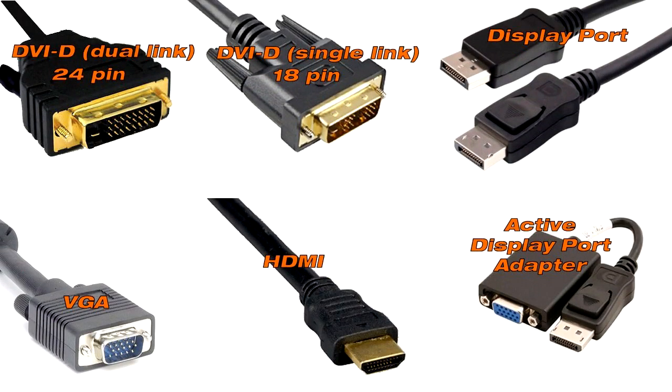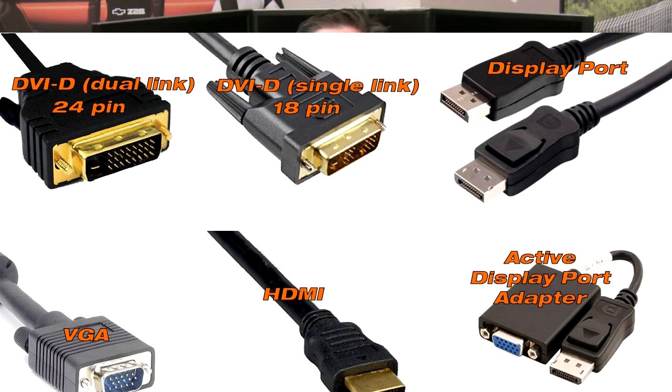You're welcome. So basically what you do is you get this DisplayPort adapter, which you can convert from the DisplayPort to a DVI, which is what we have, VGA, or HDMI. I'd recommend DVI because you can get good resolution with it. Cables are fairly inexpensive. We got a 6-foot DVI cable. Now we're going to plug it all in, show you what happens when we do that.